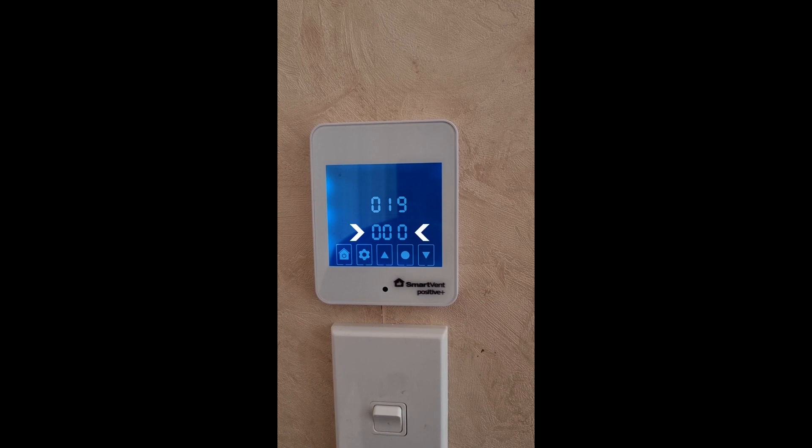With the filter life, the 000 refers to the amount of life left in the filter, and they go up by 10 percent. To set it back to 100 percent you want to set it to 010. For example, 005 is 50 percent left, 001 is 10 percent left — so it's another way you can monitor just how much life is left in your filter.